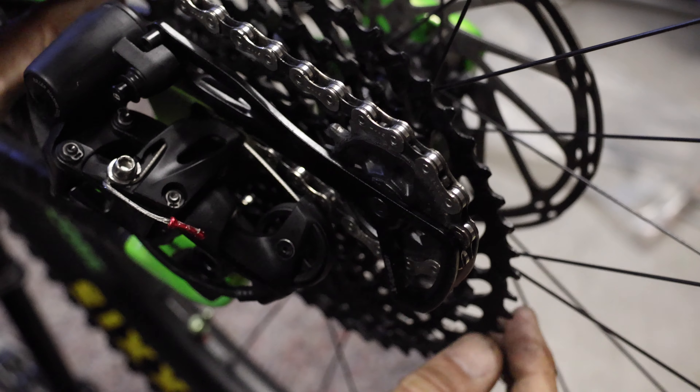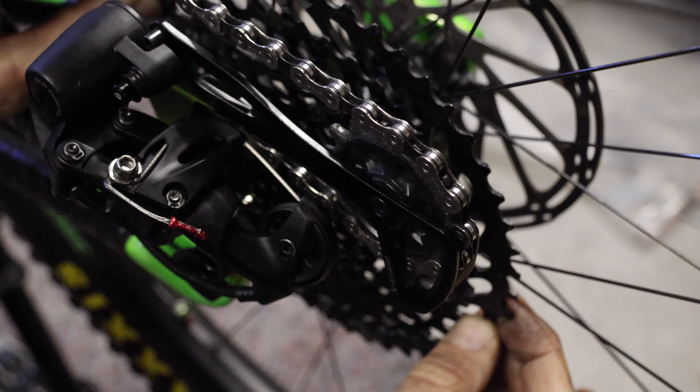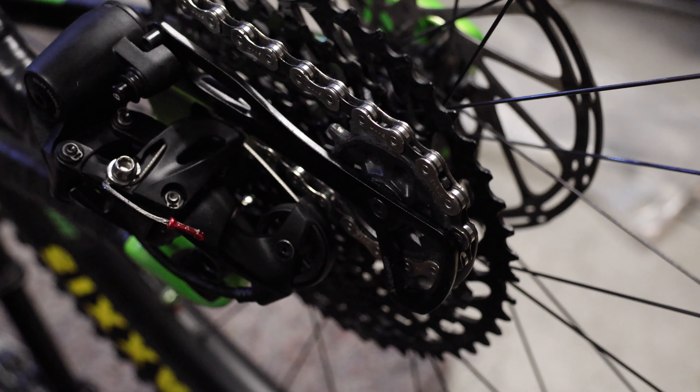We've used this driver hub for a few days riding, probably done about 40 to 50 k's, and it's got zero movement in it at all. So the cheap bearings - forget about it. ABEC 3 or ABEC 5 at least - pay $10, $15 or even upwards. I'm a little bit cautious about the ceramic bearings; I'm concerned that under high load, especially when your gears or pedal might slip, that sideways movement could actually crack those bearings. I'd actually rather have steel bearings in mine. You work out what's best for you, but at least get good quality bearings - don't just buy the cheapest things you can find.